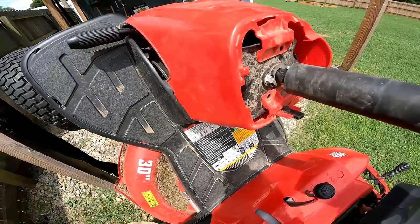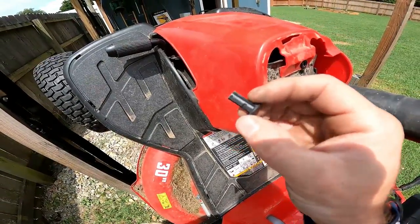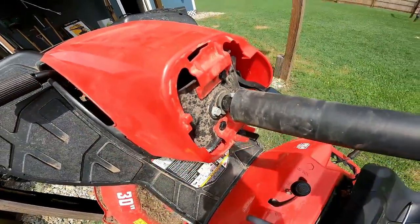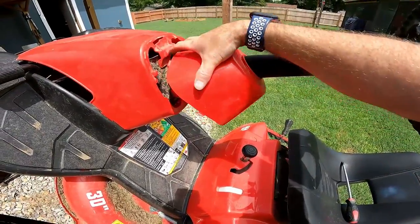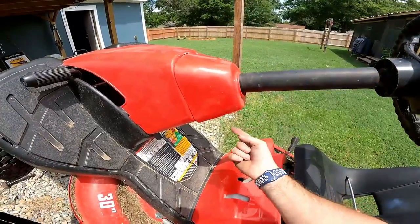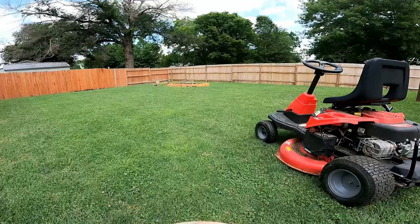Take your tab with the hole in it and pop it in here, do the same with the other one, then take this center piece and place it in — it only fits in one direction but it'll snap right in and won't come out unless you pry it out. Do the same thing on the other side. Then slide this piece down, get everything in place, snap it in. Don't forget to put the Phillips head screw in. Now that we've got it back in place, let's test this out.